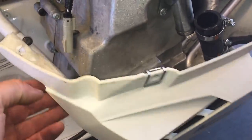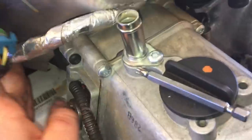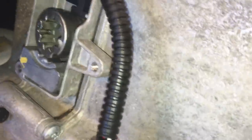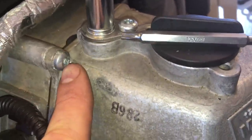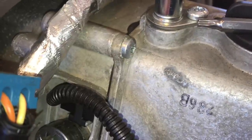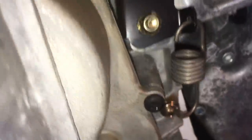I removed this little screw that holds this on so you can pull it back out of the way, and I just tuck this connector up in behind the tank. Everything's a lot more free and clear to hoist it out of here. Rather than separating the oil tank from the chain case cover, I'm just going to remove the entire oil tank and chain case cover together. I'll get all those black Torx bit screws out and see how it comes out.